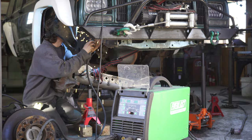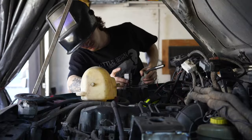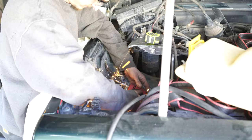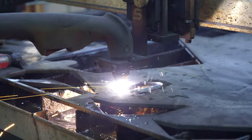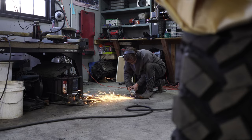Like I said, I already have just about everything I need already cut out for the passenger side. I did it all yesterday before calling it a night just so I had less to do today. I opened up the hole for the coilover a little more, cut out a rear piece for the tower, tacked it all together, and now, finally, we can drop the weight of the Jeep onto these coilovers. The coilover towers are all taken care of right now. They're all tacked into place.